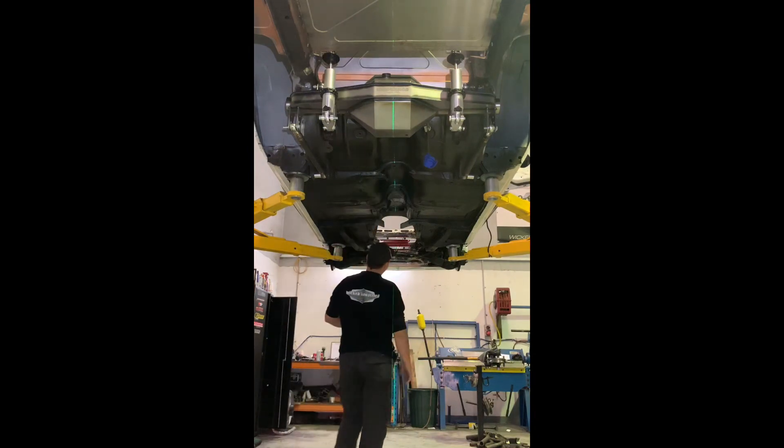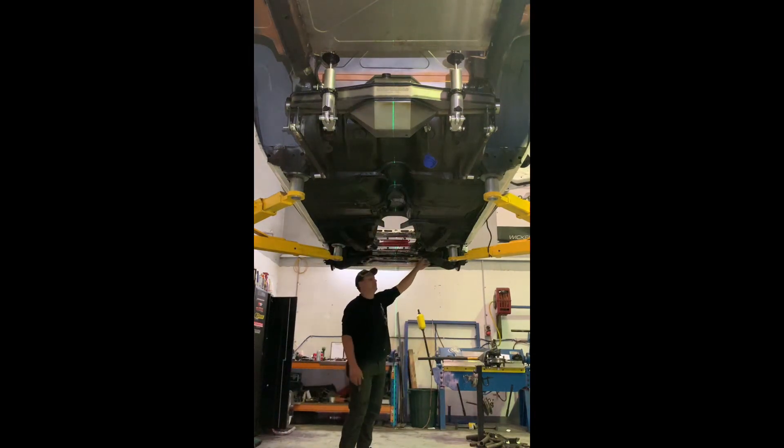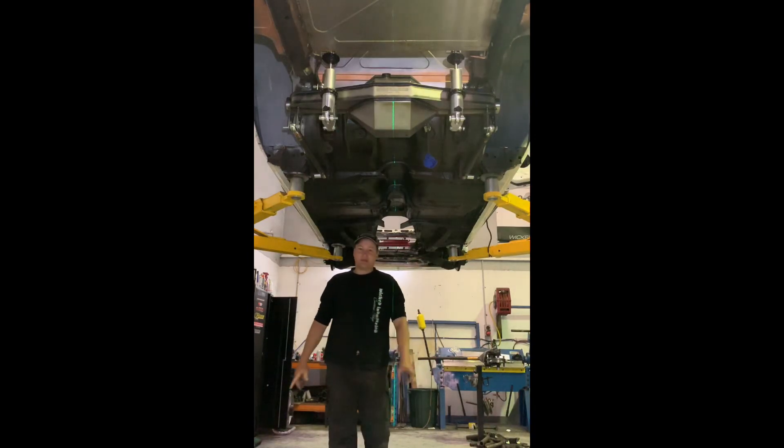When I move up to the front, I'll go up the centre of your suspension pivot points — your front points there. That's going to be the most accurate because your control arms are always going to be the same size.